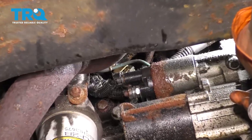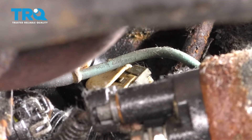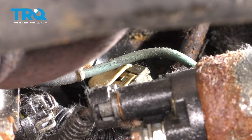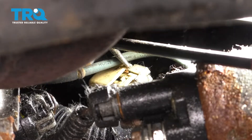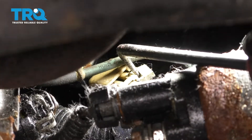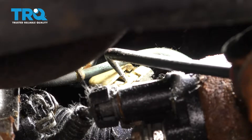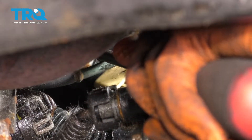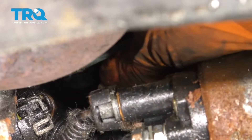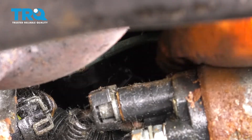If you look from the front of the vehicle, right up above the starter, this is the connector for the knock sensor - the front knock sensor. It's gonna be the same for the front and the back, so I'm gonna go ahead and unplug it first. It's got a little lock on the connector, so I'm gonna use a pick to pull that down and unlock it. Then press on the center tab, pull the connector down - there we go. Set that aside.